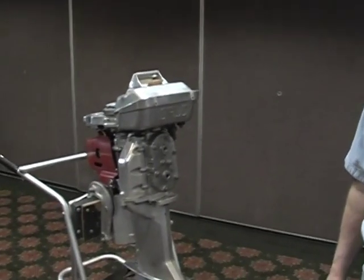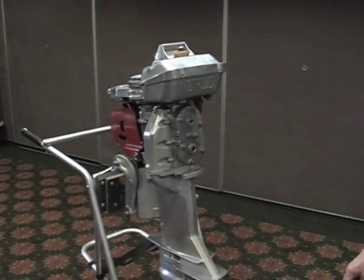This Yamato has a hemispherical head. So basically, if you set the engine up horizontally, you can add fluid till it comes out the spark plug hole. Makes it a relatively easy, straightforward process to CC.